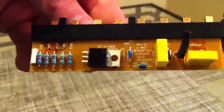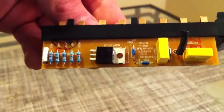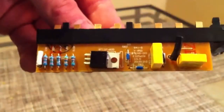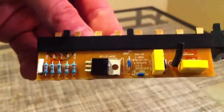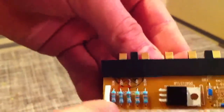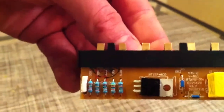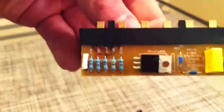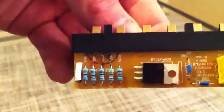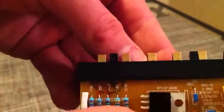These are the 2 blue resistors, which are for the high and low feature. They have a certain resistance, and they become connected after the high or low button is pressed down, and you can either hit the smoothie button or one of the others, and it will connect one of these other 5 resistors, each of which has different resistances, and those resistances will create an equivalent resistance, which in turn will limit the amount of current that flows through the circuit.